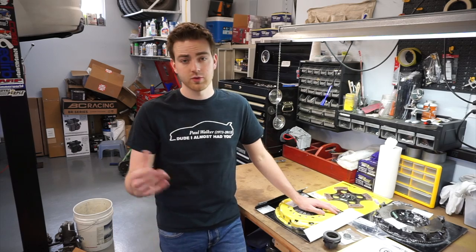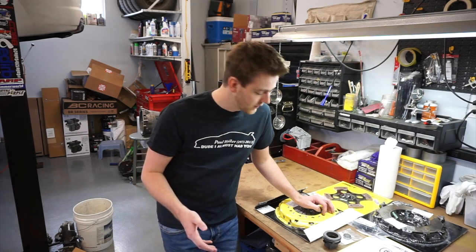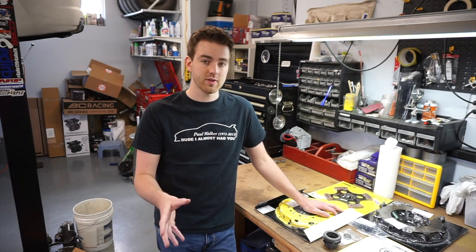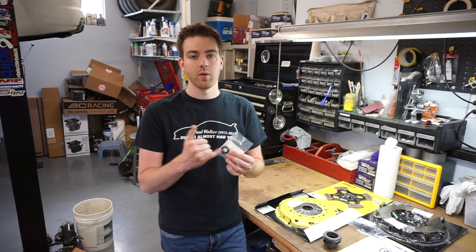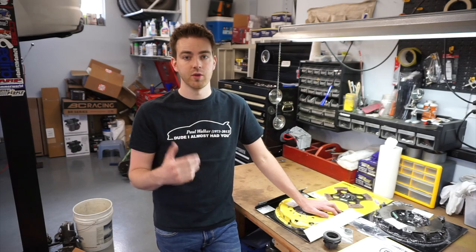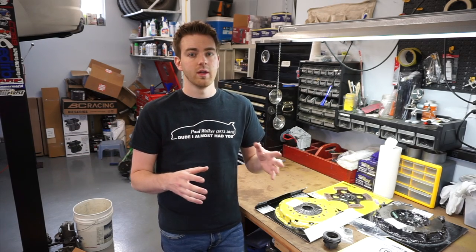Story time, and I hope this experience will help anybody out there looking to do a clutch system so you don't run into the same issues I had. Originally I had the ECS Tuning Stage 2 clutch, which is rated for 400 horsepower and 400 pound-feet of torque conservatively. What happened — and I did a video on this — is the pilot bearing exploded. Once the bearings got out of there, it went all over the clutch and ruined the entire system. ECS Tuning was really cool; they returned the old damaged one and sent me a new one, which is great customer service.